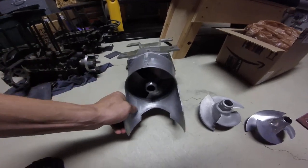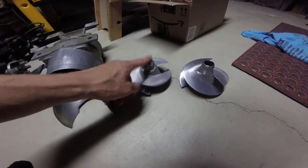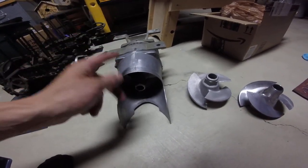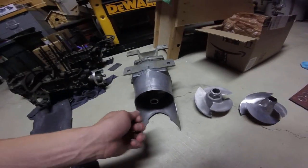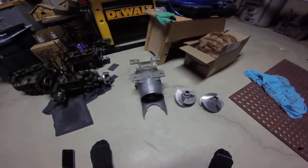And the clearance should be so close that on my pump that I put together, where I replaced this stock impeller with a perfect condition 15, the clearance was so close that it was actually barely rubbing the ring at one spot. Like you hear a little ting as you spun it by hand. So that is a really good way to know that your clearance is close.